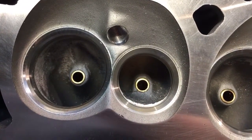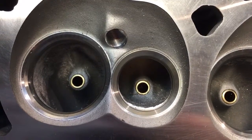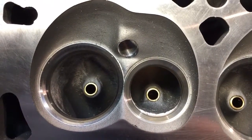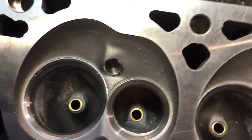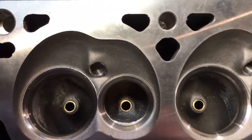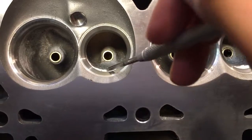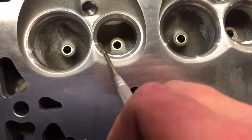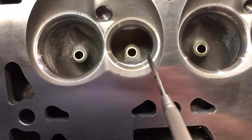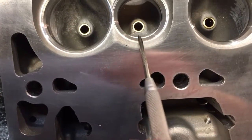I've already done the other half of this bowl and I'm just working my way around it, because this back side requires a lot of material removal with blending without excessive digging. When you're porting your heads, you don't want to dig back that way — you don't want to go way back there. Remember what we talked about: line of sight. Air wants to come out of that port with the least amount of hassle it can. So when it comes up this port, you want it to be able to climb out of this back wall as quickly as possible.